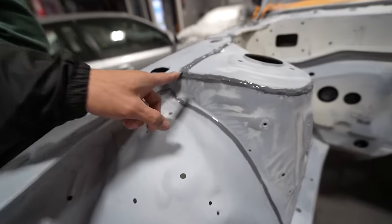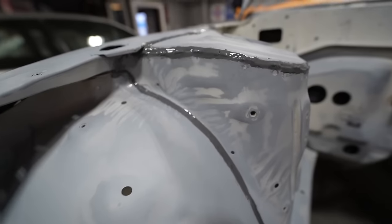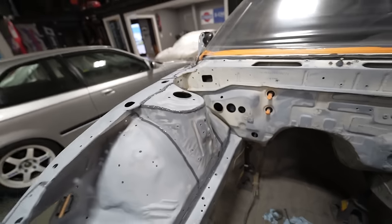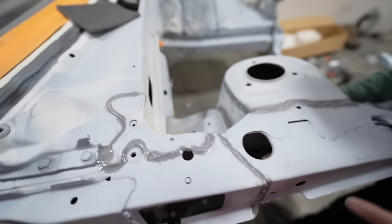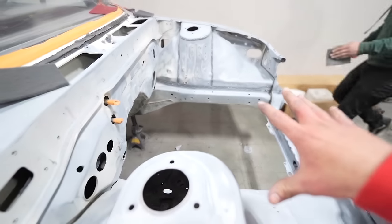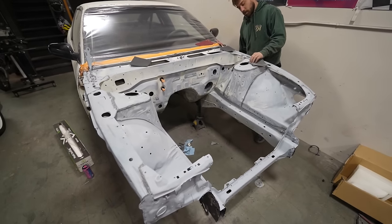You shot the spot of the welds? Oh, yeah. They're all front end. Stiff as a brick. A lot of seam sealer. So we're gonna scuff this once he's done doing it, and then base, then paint. The colors, you guys aren't gonna guess the color, but you'll see it. Everything's moving lickety split over here, all the seam sealer, etch primer, gray Scotch-Brite. Brian is now hitting it with 800 just to clean it up a little bit, and then we're gonna wax and grease, clean it, and then sealer. Pretty fucking cool though.